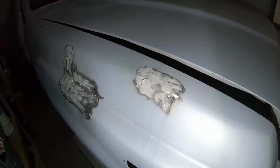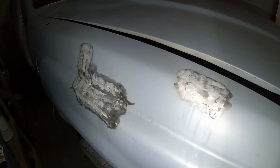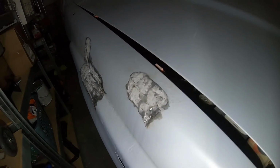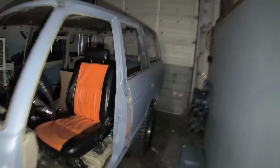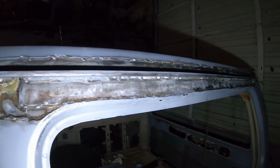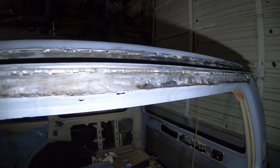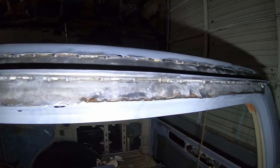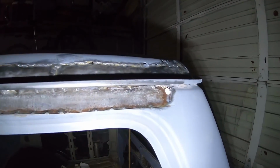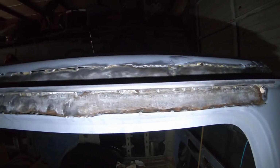You can see the metal prep starting to etch the metal. So it's looking kind of like that white color. And we'll take a look on the other side. And we sprayed over here, so you saw what it looked like before we sprayed it. And so I think we're like 2 coats in, and you can see it's starting to have that white finish. So it's starting to etch the metal. And we'll probably have to give it another coat or so before we're ready for POR-15.